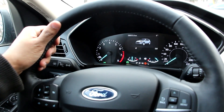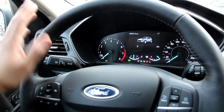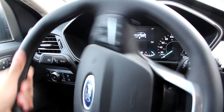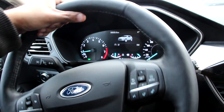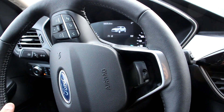Here's a look at the electric steering rack on the Ford Escape — there is no motor located here. In fact it's located on the steering column, and if you look closely you can see the electric steering motor underneath the dash. One thing with this start-stop system is that although we have electric power steering, the electric power steering itself doesn't work even though it could still be powered by battery. With the engine cut off, if I turn the wheel it'll actually turn the car on and then I get assist. Since it's electric steering it should allow you to maneuver the wheel, but it doesn't.